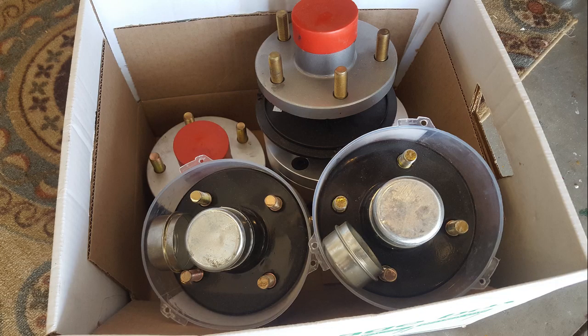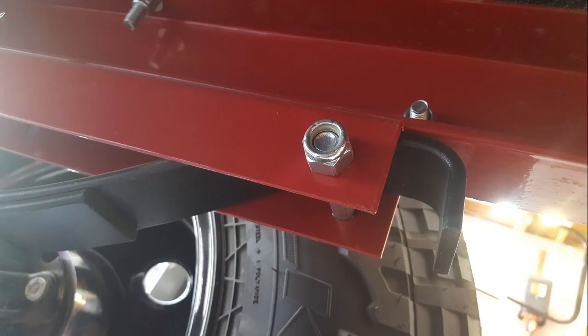The bearings are Mickey Mouse. Today I'm going to tear that apart. I have other bearings here at the house — I've got like six sets of hubs. If I can't make it work, I'm going to just wipe out one big problem with one stone because I don't like the leaf springs. They have a mount on the front and then they just bend and rest right on the axle steel like the old-time trailers do. I would like to have spring hanger bolts at both ends. For like 150 bucks I can get an axle that will take the five-lug hub with no play, bearings will work. I can weld in new spring hanger brackets, put all new stuff under there, and move the axle back about six inches to make the weight distribution a little more forward since I have stuff hanging off the back.